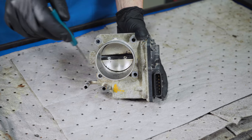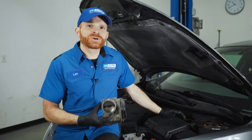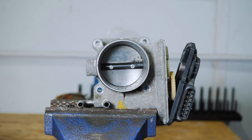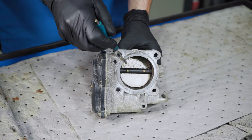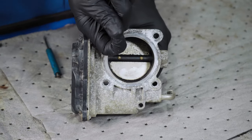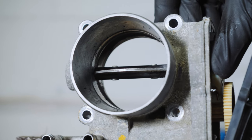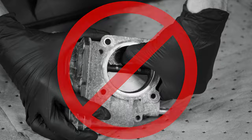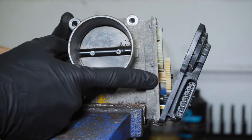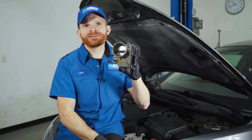Common reasons for this could be the fact that your throttle body itself is dirty. If you find your air filter housing in the engine compartment and follow the air inlet tube, it's going to lead you all the way down to your throttle body. Looking from the outside where that air inlet tube is, it might not look so dirty, but if you remove it from the intake and look along the backside, that's typically where you're going to see a whole bunch of black soot or carbon accumulating, causing a restriction of your butterfly valve located inside. That valve controls the amount of air drawn into the engine. If you were to reach inside and push on it to clean it, you're going to cause calibration issues — behind the cover there's a whole bunch of gears, so be careful.